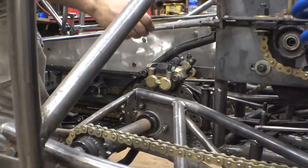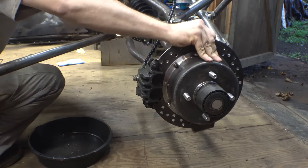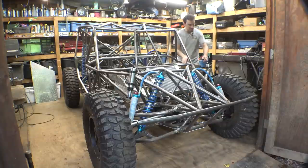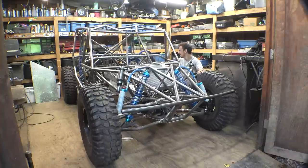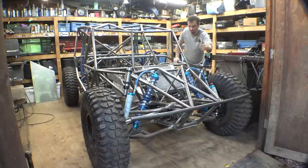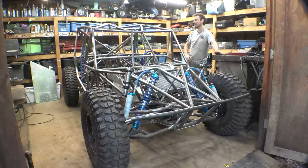I think that's tight enough. The rear is on. Let's test if the front works. Seems like they're working. Brakes are installed. I'm going to push this thing forward and slam on the brakes and see what happens. Not bad - at least it stops it. The true test is going to be obviously driving this thing because we're really not going to be able to tell if they work just by pushing it. Hopefully these brakes are strong enough - I know they are motorcycle calipers and go-kart master cylinders, but hopefully they're strong enough to stop this huge thing.